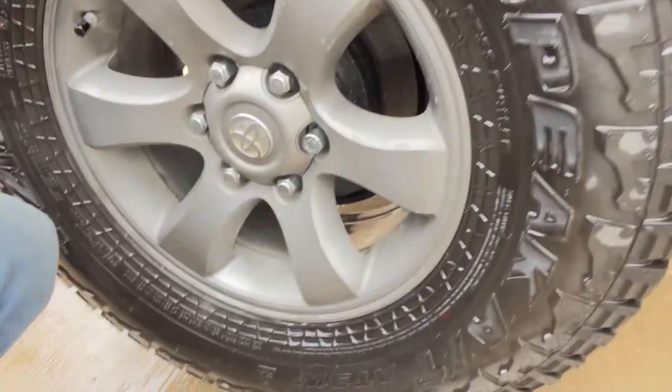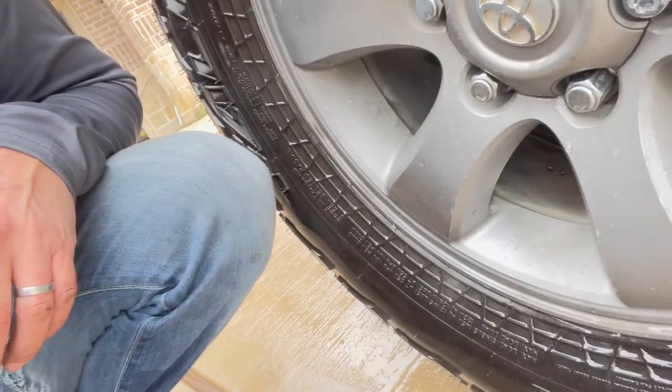And just power washed everything because it was pretty grimy in there. Might wipe it down a bit more. But yep, pretty happy with that. It's looking good. Sounds good, and I think that's gonna do the trick. So I'll keep an eye on that, make sure that replacing the seal is the thing I needed to do, but I'm pretty sure that little tear in the seal was not there. I don't think I hit that with the axle, so pretty sure that's probably what caused it, and got an OEM Toyota seal in there, so I think that's gonna do the trick.